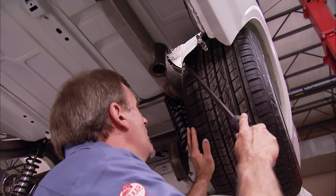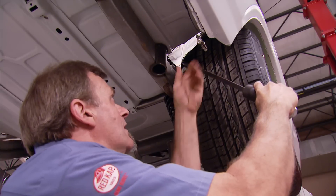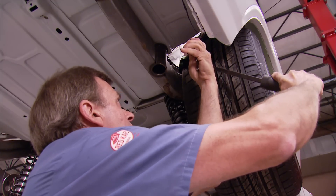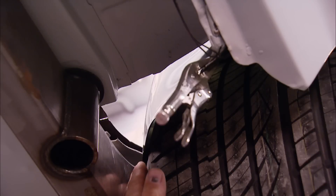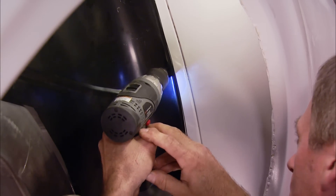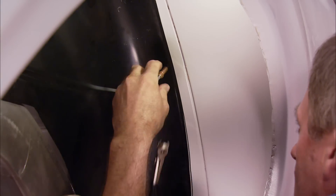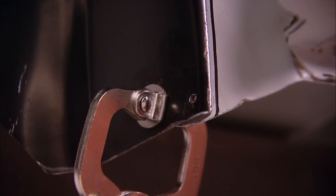We only have one small area that's going to be a problem, where the tire is just touching the bottom of the new inner wheel well. So I'll disconnect the vise grips and push it back away from the tire and let it move — and yes, it stays. So I just have to move it rather than trim it, and we should be good to go. You can see from where the original seam is and where the new one will be just how much space we've gained. It may not seem like a lot, but when it comes to oversized wheels and tires under a car, you need every inch you can get.